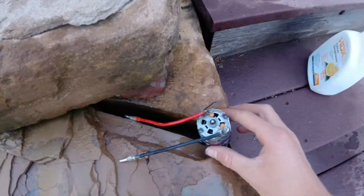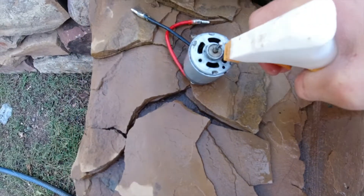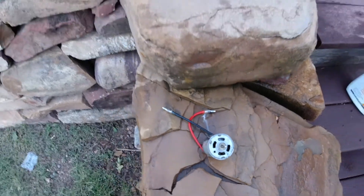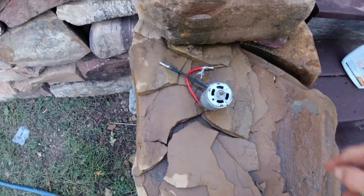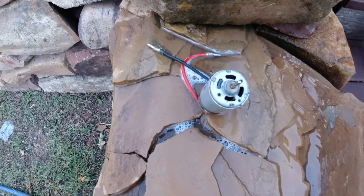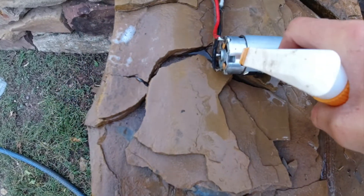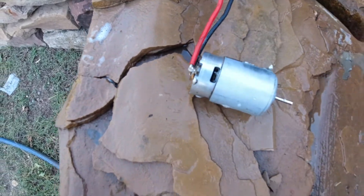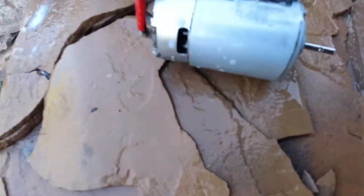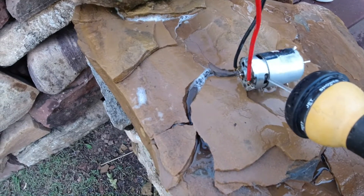This is the back of the motor where the wires are. I did it on my axial motor too. Then flip it over and take the cleaner and spray it into this side the same way. Just spray it, clean it out, shoot it through there - run it pretty slow. We did this side, this side, and the last holes on the side - just spray all those, rotate them, spray them all. Then take some water and spray it in there.